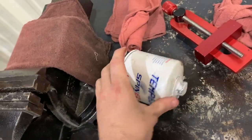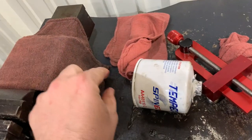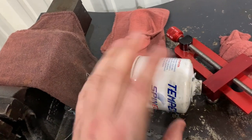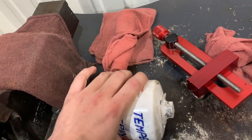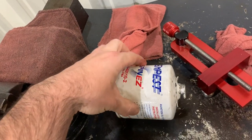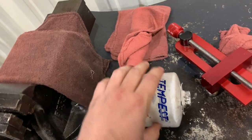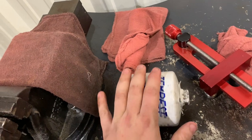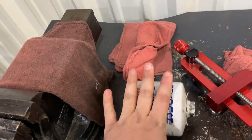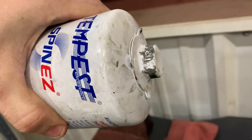I'm about to cut this filter open, but I think I figured out what happened and why that safety wire was so messed up. As far as it being loosening up on the old temp sensor wire, that was just messed up — foobar. A trick that people do is they will over-tighten the filter and then run their safety wire loose, and then back off the filter to make their safety wire look tight. In this situation, I'm guessing the person forgot to loosen the safety wire back, which meant it sat there super tight, and then we had to get a pipe wrench to take it off.